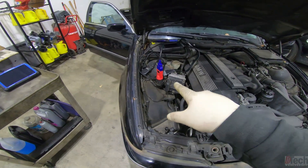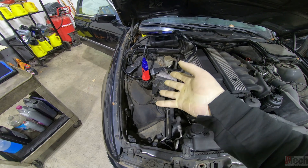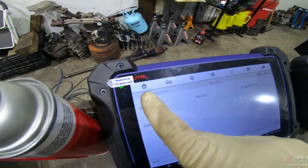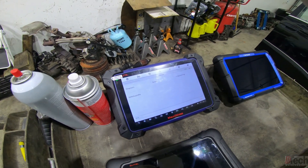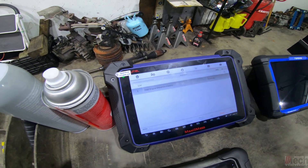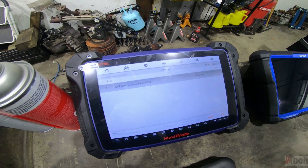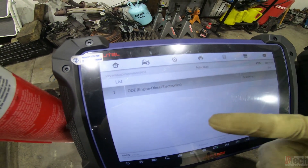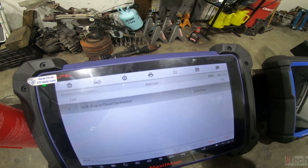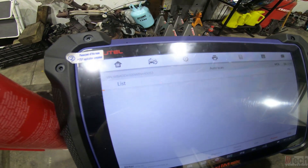Today I went in to try to scan and start diagnosing a bus communication problem, and it actually started to scan. I did an automatic identification and it pulled up the VIN number correctly, so I was surprised to have communication. I'll show you what I ran into — I'll hit auto scan. This is the IM608 I've been using lately. When it cycles through and doesn't populate a list, it means it's reaching out to scan but either not finding modules because they're not equipped or they're not communicating.